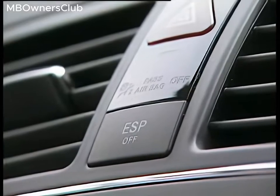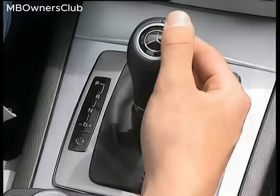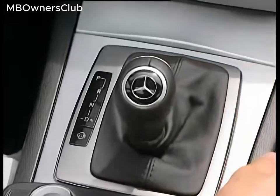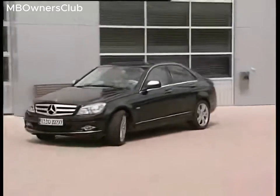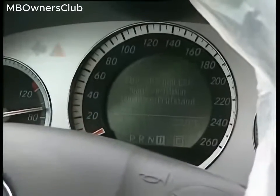Perform the next steps within a maximum of 10 seconds. The ESP warning lamp flashes briefly and then lights up permanently. Actuate the brake. Shift to drive position, or to first gear on vehicles with manual transmission. Drive through a quarter turn at approximately 10 kilometers per hour. The steering angle must be greater than 90 degrees.